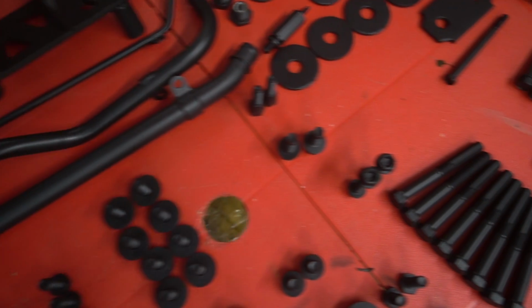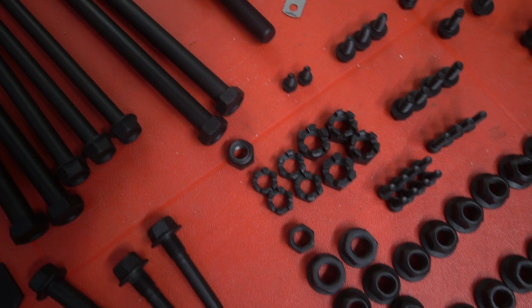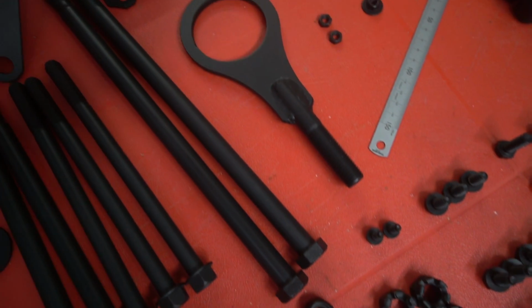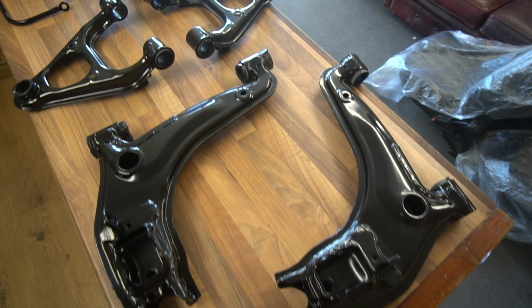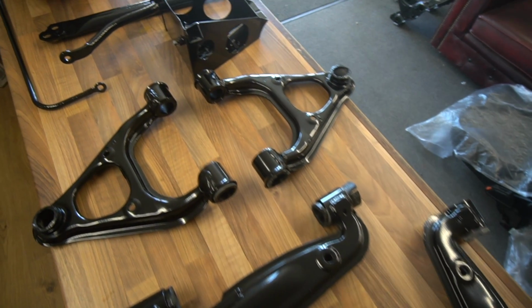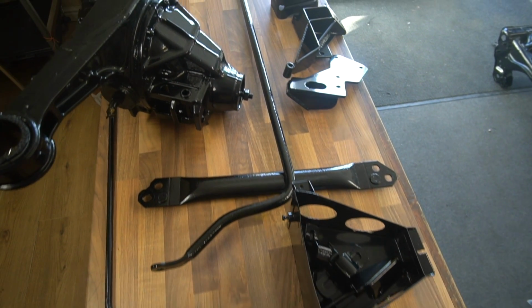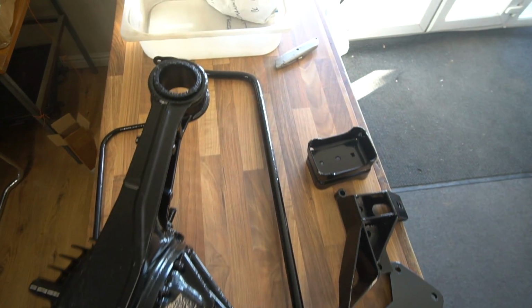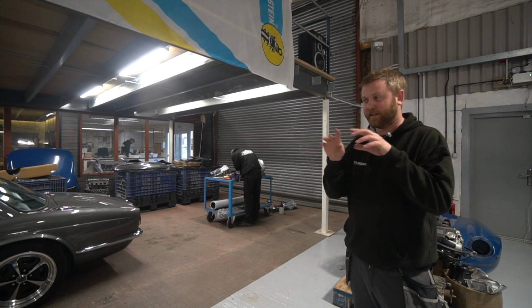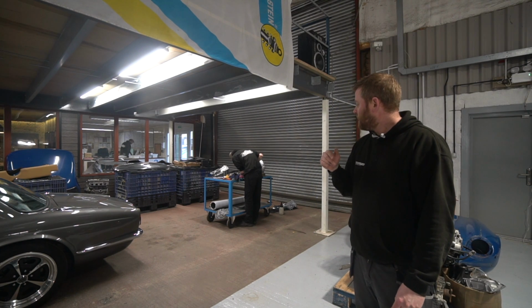But as it is a sprayed coating, it doesn't necessarily protect against corrosion on something where you can't get it onto all the faces. So things like the wishbones or the diff casing on that car, we still choose powder coat, because on those we can blast it, zinc metal spray it, and then powder coat it. And although that's also line of sight, so you can't necessarily get inside the higher sections of the wishbone, the zinc metal spray acts as a sacrificial coating and protects things that are even just near it, in terms of the steel in the surrounding areas, and that's why we use it on the underbody coatings on cars as well. So that's what's been going on there.